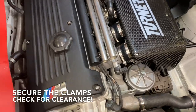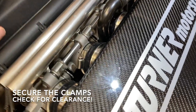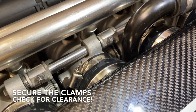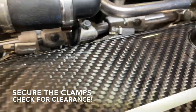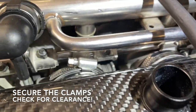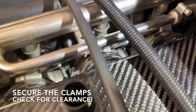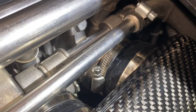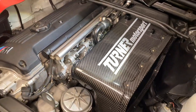We're going to show you the positions of our clamps. This one we got right over here, out of the way of everything. Parts like these on the throttle system are what you have to watch out for. These ones are a little more difficult, but we can see that's not in the way of anything — we got clearance. The next one, we have clearance. And over here it gets difficult to see, but once again clearance. And the last one, clearance. Double check that, tighten down, and you're good.